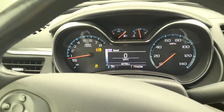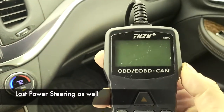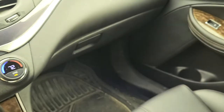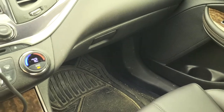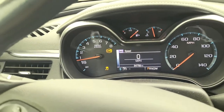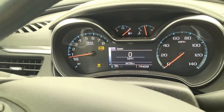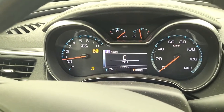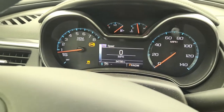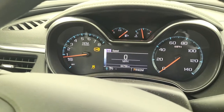I'm checking the ABS and Stabilitrac codes, and the little inexpensive reader I was using doesn't read anything but OBD-2 codes, so it couldn't read anything for the ABS or the traction control system. So I did some quick research and ended up purchasing a relatively inexpensive Chinese-made scanner that does OBD, ABS, and the SRS — the Supplemental Restraint — and a couple other modules.